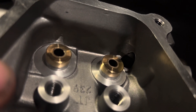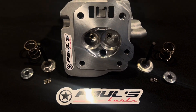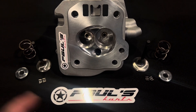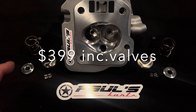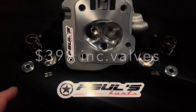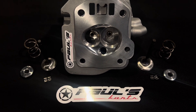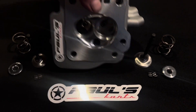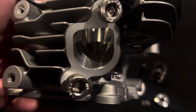We cut the seat pockets and size the ID so that the guide locates the inner coil on the dual 60-pound springs with a click fit — a nice strong, stable platform for high RPM. This does come with the valve train. The 32/28 comes with the 37-pound red stripe springs, billet retainers, and includes the keepers.